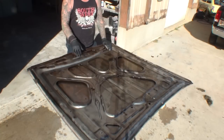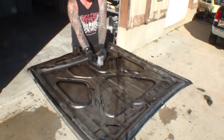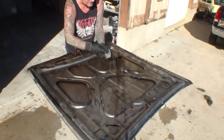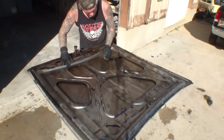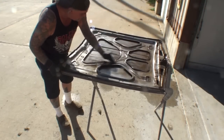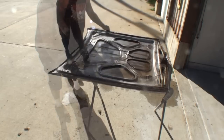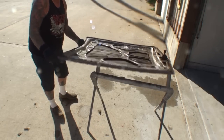Once you've applied the vinegar water using your throwaway brush, you're going to want to take a piece of coarse steel wool, just like you're looking at here. And then what we're going to do is come in and basically scrub down our metal, especially wherever there's any surface rust. One thing you do want to be careful about when you're cleaning off your metal is the sharp edges. So we're going to go ahead and get some of that back over in that side of it.